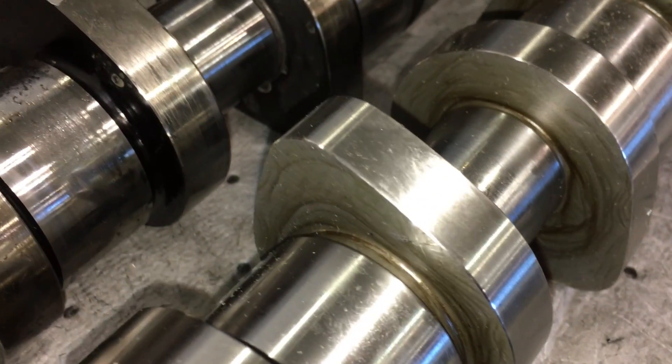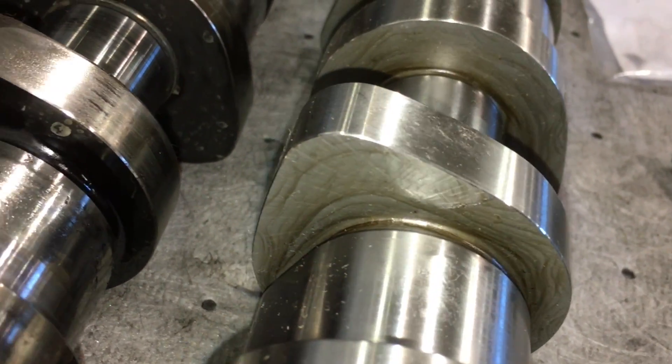As far as average miles to failure, this is a pretty high-mileage failure — I've seen most of them fail over a hundred thousand miles, though that's not to say they can't fail under that. We've seen these mostly in the Golf, Beetle, and Jetta family. Not so much in the Passat, though the worn camshaft shown earlier comparing the two was actually out of a 2004 Passat. So there you have it — all about the failure of the 2.0 and 1.9 liter TDI camshafts, roughly 2003 to 2005.